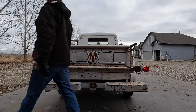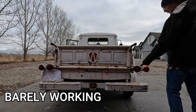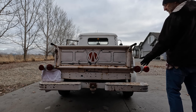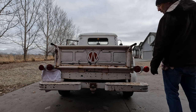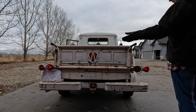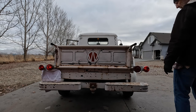Did that just burn out? Let's just try blinkers only. Well, if both of these are working with the blinker on but not with the taillight, that means that this is probably a dual filament bulb and one of the filaments is burnt out. Or something is wrong with the wiring. These are just the taillights again, and you can see that this one is not working at all, so might have to get a new bulb for that one.